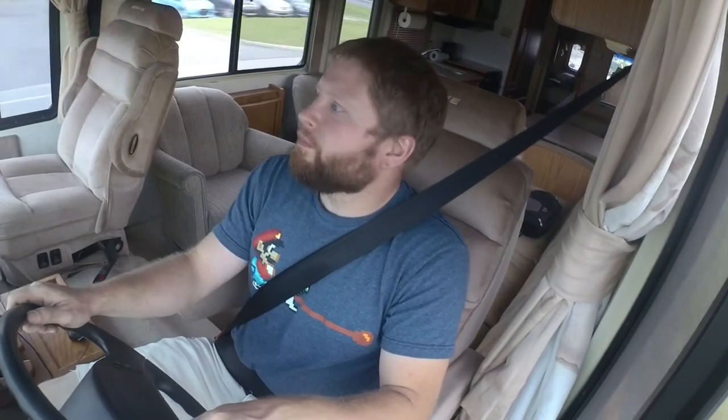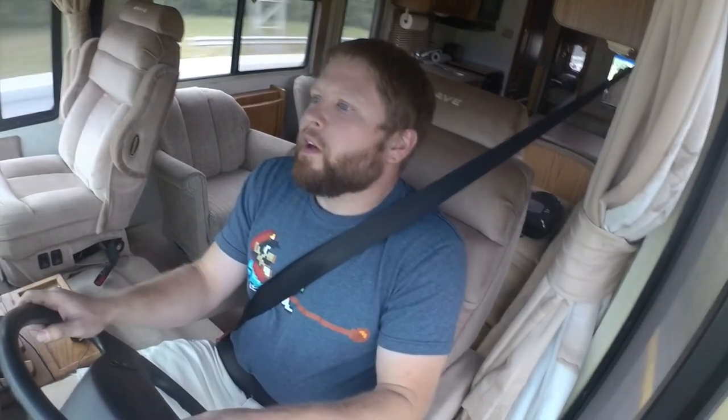The rear doesn't seem to be quite as noticeable a difference, but I'm also usually towing a trailer if I'm actually driving any distance and that adds some weight to the back. So maybe that'll make it ride a little bit smoother when it's got all the weight on it. When I took the old shocks off I confirmed that they still had nitrogen charge and there wasn't oil leaking out of them anywhere. By every test I can do by hand they seem to function properly.